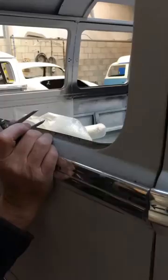Do not insert the screws in every hole. Wait until the bus is painted. We supply zinc plated steel screws, as stainless screws are cheesy and will only stand one insertion. They also snap easily or strip their threads and create bimetal corrosion, so don't use them.